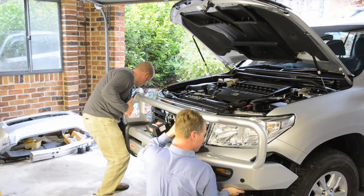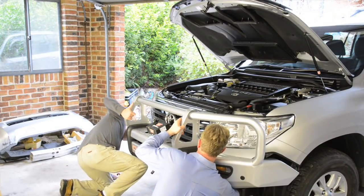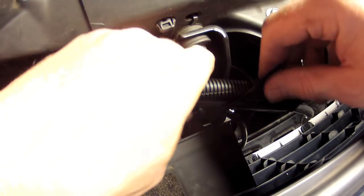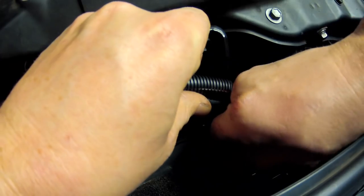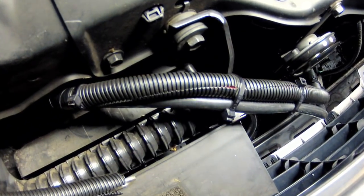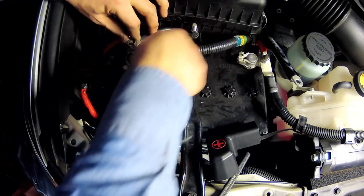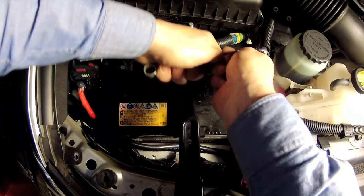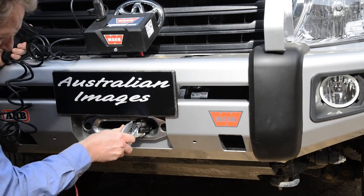With the aid of an assistant, you can now replace the bull bar on the vehicle and fully tension all the bull bar mounting systems. Next, run the power leads from the winch to the battery. Ensure that both leads are well secured with cable ties to prevent any risk of abrasion damage. For additional protection against a short, encase the entire positive battery lead in split tubing. And for best performance, connect both the positive and negative leads directly to the battery. You can then fit the hook to the rope and check the operation of the winch before heading out for a field test.